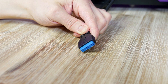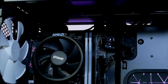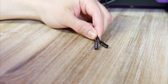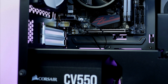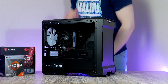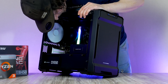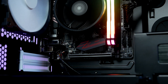Start with the USB 3 connector — it's located on the right side of the motherboard. Front audio goes to the left side corner. The front panel connector is right next to the front audio. That's pretty much it — flip the case around, put on the side panel, and we've officially completed our $598 budget mini gaming PC.